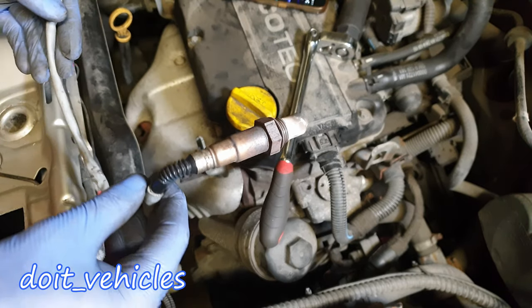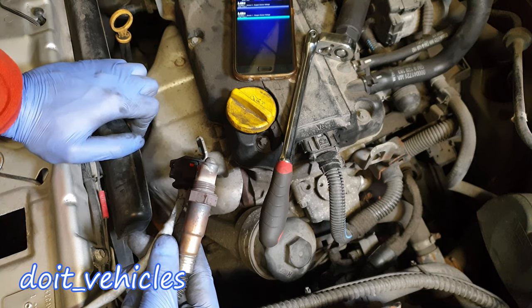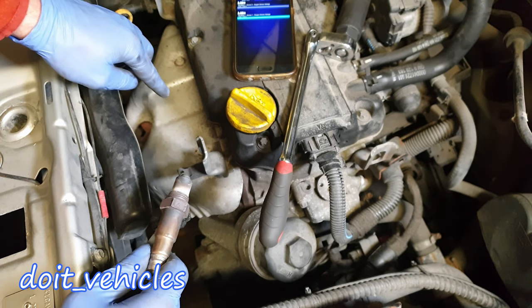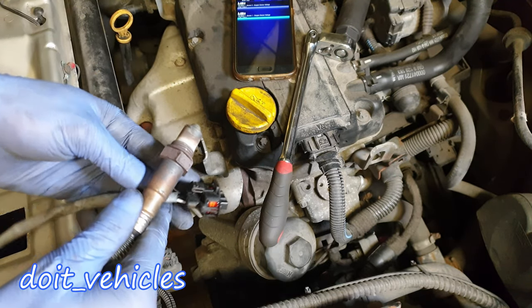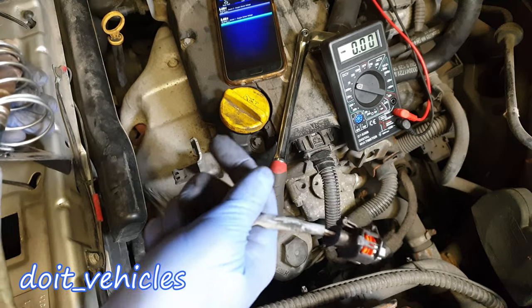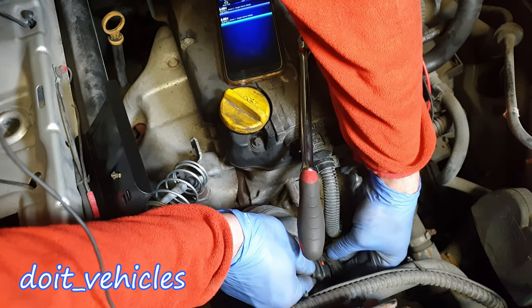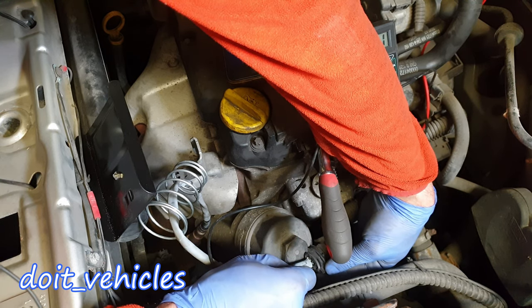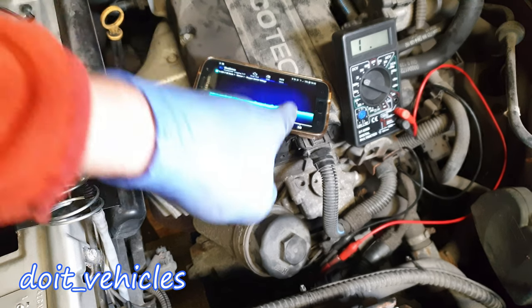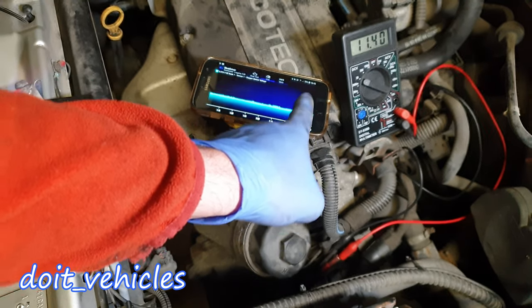Open it up and make sure it's cool enough to touch. Another thing you can do, if you suspect that sensor 1 is broken, is swap it with sensor 2. While I wait for the exhaust manifold to cool down, I'll show you another test you can do with oxygen sensor 1. I'm going to place the oxygen sensor on a support and plug it back into the connector, then back-probe the ground and the signal wire. Even though the heater circuit is bad, the oxygen sensor can still read values if you heat it up externally — and you should see both an increase and decrease in reading.